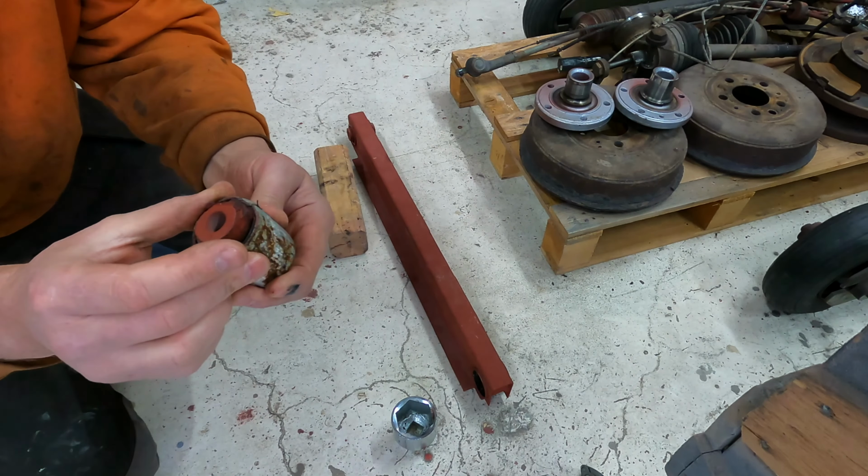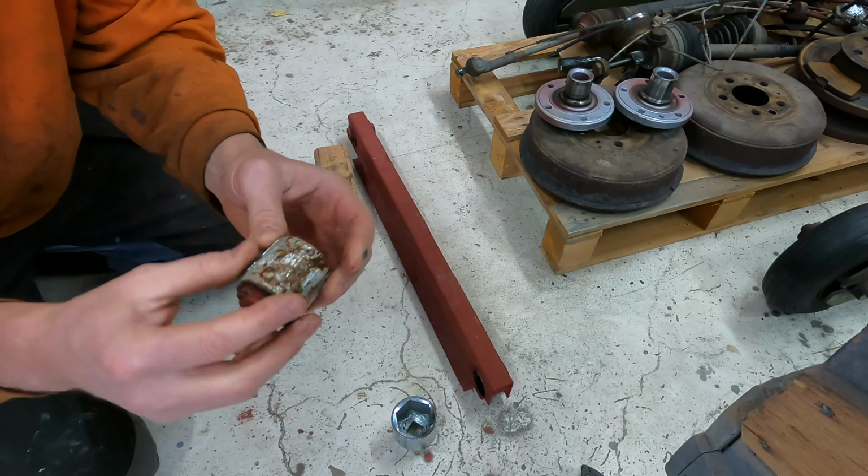Is it aluminum or what is it? But it's very lightweight. Take off. Another side. It's not tight. Let's hope we get the right ones. So you clean them with the degreaser. Now the rust is off, so just clean the surface and put the welding primer on. So then I can weld this back together.